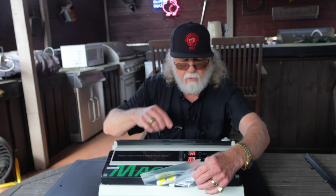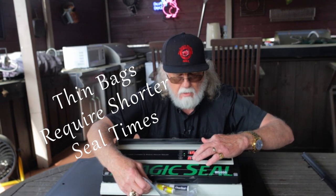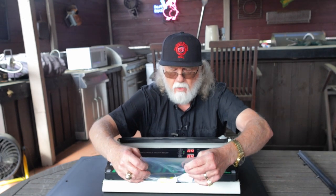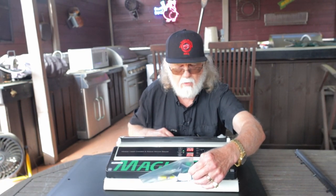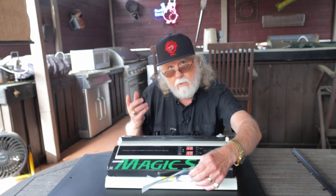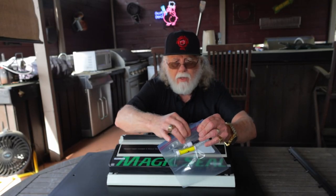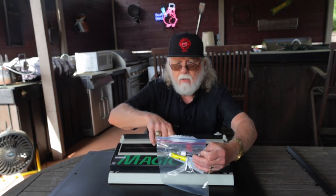Get your product forward. We want to change our seal timer — going down to four seconds using the minus button. I've got the seal timer set to four seconds. Hit the auto button; the countdown timer for vacuum starts working. The vacuum nozzle retracts, the seal timer starts its four-second count, we get the beep. Press down on the lid, both sides, press the buttons in. You can go ahead and snap that together on top if you feel better, and you've got a very wide seal.